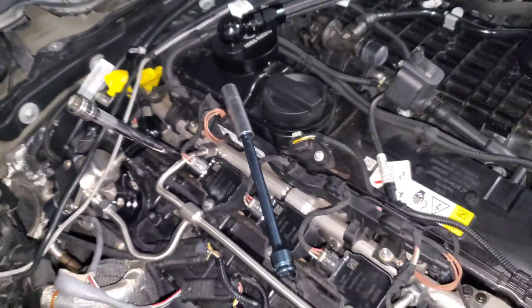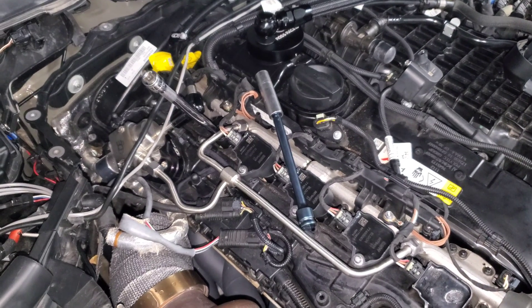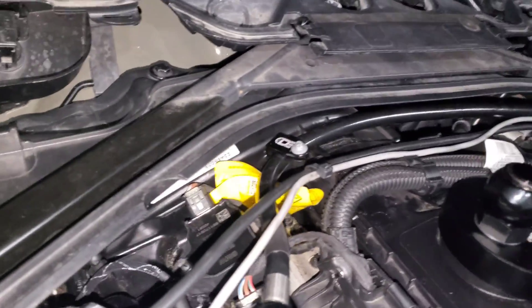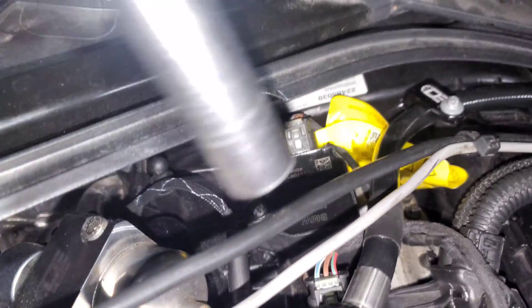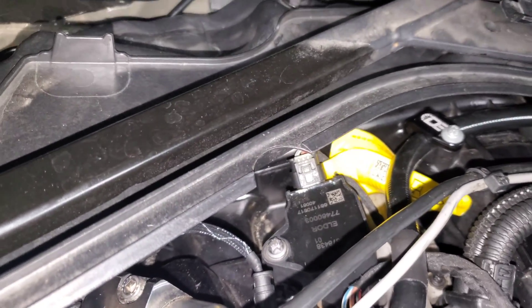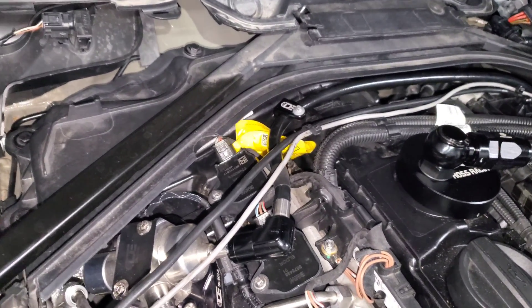Go ahead and remove the plug — installation is just the reverse of removal. Remove all your plugs, swap them out, and then we're going to read them. One other tip: if you leave the sound deadening off the back of the engine, you can actually access cylinder six without removing any trim. BMW even gives you a little relief in the plastic for extra room to get your spark plug tool down there, so if you don't mind a little extra HPFP noise, leaving the sound deadening off makes future spark plug changes a lot easier.